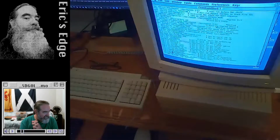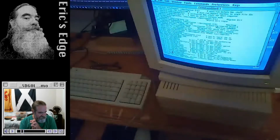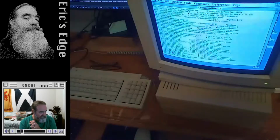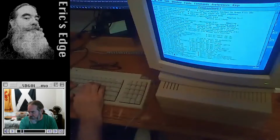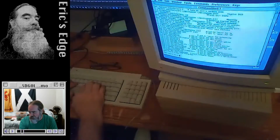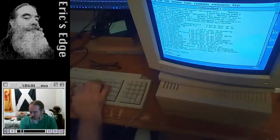So that should be all that has to happen in inittab. You can set the default route in rc by adding the following line. Of course, you will need to change the IP address to reflect that of your gateway. That happens to be the IP address of my gateway. So let's do that. I think we're done here. Write quit. Okay, so we're going to cp rc to rc.2022 10. Whoops, 8 10. That's rc. All right, virc.